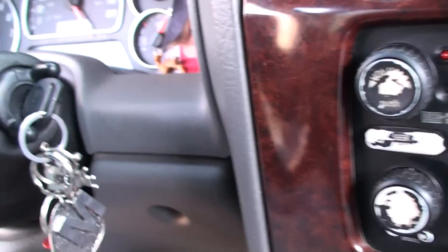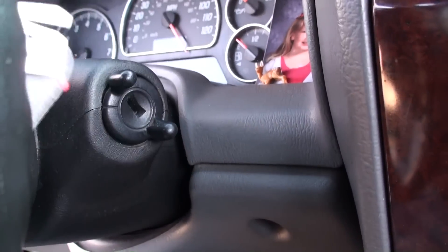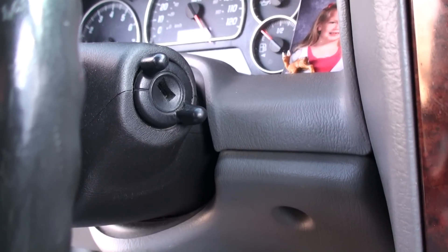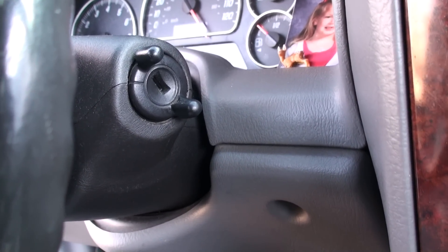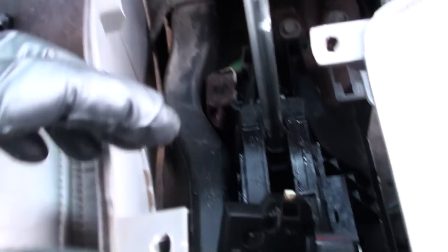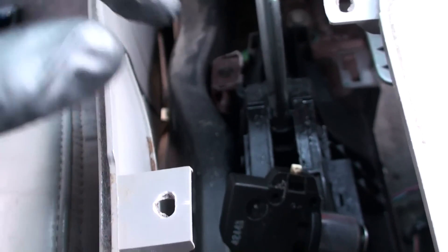Let's go ahead and see if it removes your key — and there's your key. So that right there tells you: if you've got coke or anything else, dog hairs, someone spills a drink in there — it will actually mess up the solenoid, the little switch down here. It doesn't know to release, and then you can't get your key out.